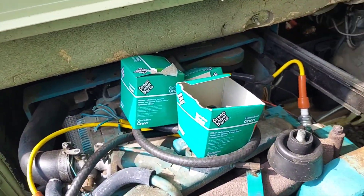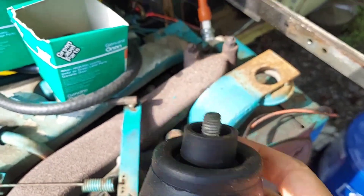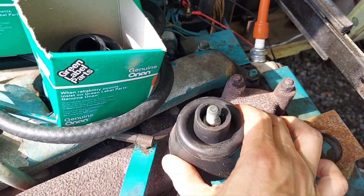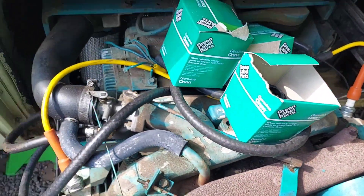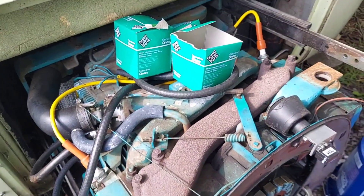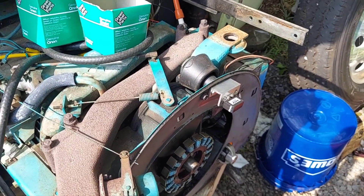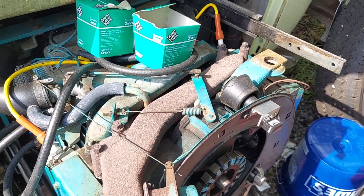Anyway, I got the old button down. I got these new motor mounts — rubber isolator bushings they call them. They go right in there, and then there's a bracket that bolts to the slider for the front mount. There are three other mounts too. So what I'm doing today is replacing those, putting the flywheel back on, changing the oil, and firing it up — we'll see what happens.